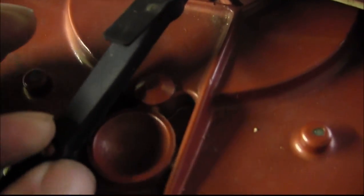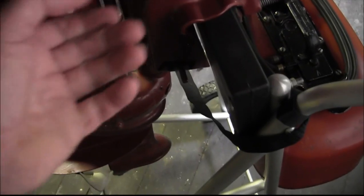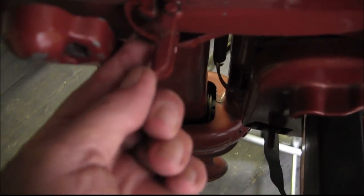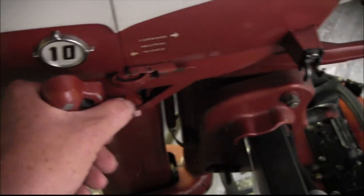There's a couple of rubber isolators which go into these 2 receivers, which you see here on the back of the motor. And all those do is isolate the vibration from the cover. The cover has a small hinge right there in the center. And we have this little strap that goes on here, so that if you're out in the water and you take it apart, you don't drop this entire assembly, because these do not float. And then, simple matter, dropping her into place, little tap, get the gear shift out of the way, reattach this, and bingo, there you go.